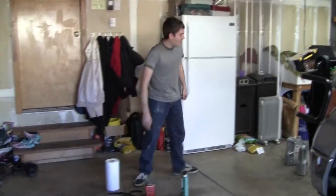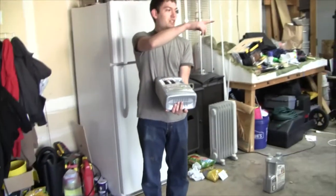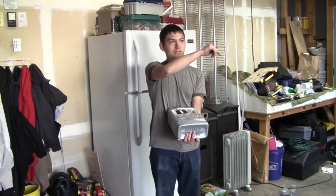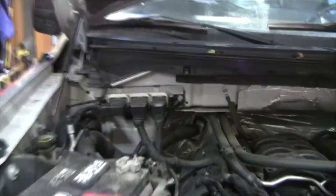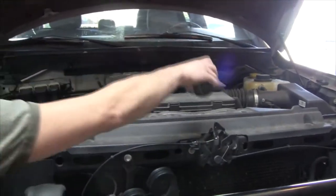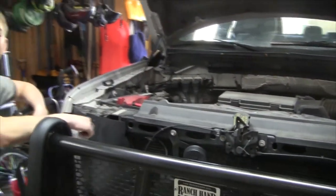The oil we'll be using today is 5W-20. You can find this in the owner's manual and also on the oil cap — it's on the passenger side on this truck. A good skill I've learned is to always put the oil cap on top of the hood release. That way you never forget to put it back on.